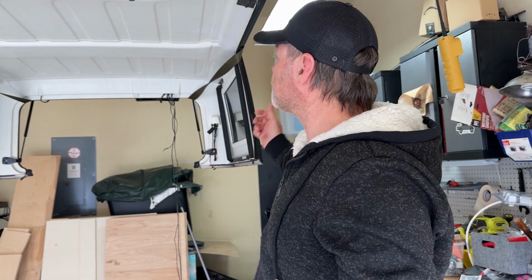So I'm going to go ahead and put Loctite on this. I've heard so many stories on YouTube from other people who have this system that these screws just rattle themselves loose on the trail and off-road. So instead of having to go back and fix it at a later time, I'm going to go ahead before I even finish the install and throw some Loctite on these screws. Take care of it now. Once I finish that, we will go ahead and put the platform system on there.